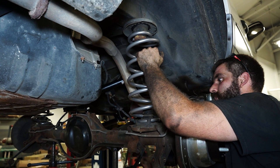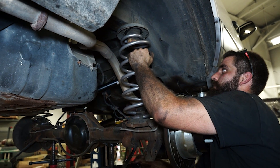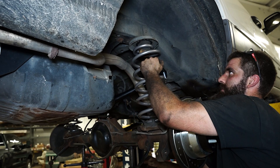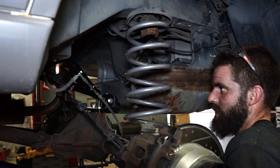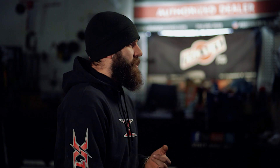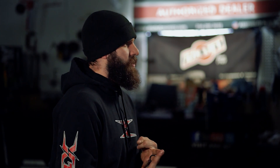One thing you will notice in the video is my factory bump stop area is rusted out. I'm going to end up welding it just like I did the front axle portions — this will allow me to install the bump stop back in so that way I don't have any suspension issues. Once you get those installed, get your springs on it, then you're going to install your shocks.